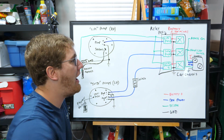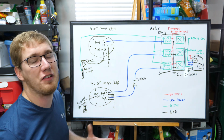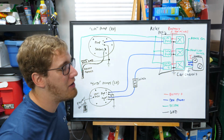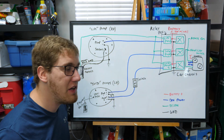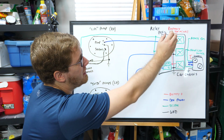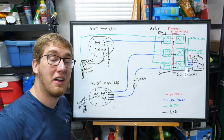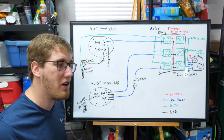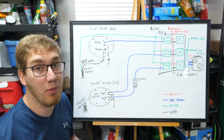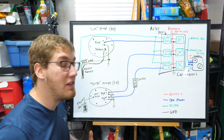So because of the fact that I have 3 relays here, it becomes convenient to try and organize this in one easy to access location where you can maintenance everything. The relay box that I have here was a suggestion that was given to me by Eugene. I'll leave a link again in the description below showing where you can get this. But the idea is that you can just stick these 6 relays all in one location. I've got 3 spares now in case I want to add in some additional power electronics, whether it be something related to the sound system or maybe an aftermarket horn. I've got these 3 additional relays which are just there in case I need them.